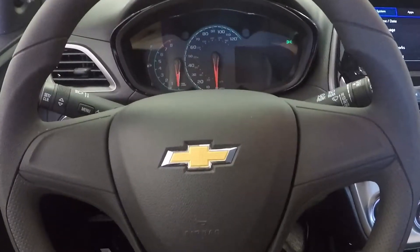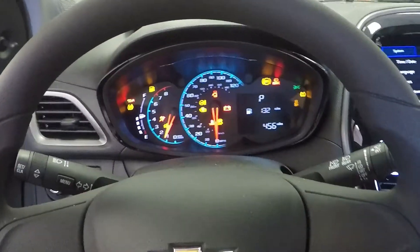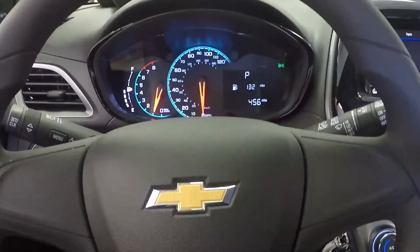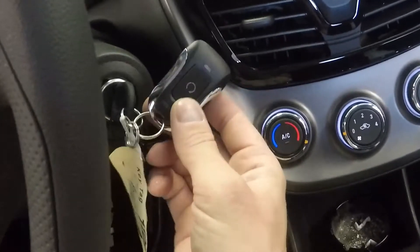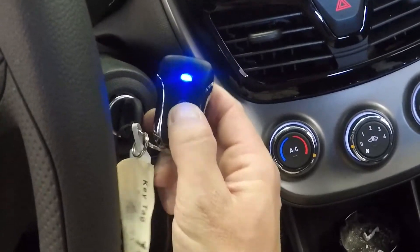Here's a quick tip for all of our GM kits — this is called pit stop mode. We're going to start the vehicle normally. Say you want to drive to a gas station and it's really cold out; you want to leave the heater on in the middle of winter, run in, grab a coffee, and come back out. On the remote, just push and hold it to activate remote start — push it for about three seconds and you'll hear a couple clicks under the dash.